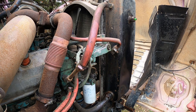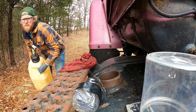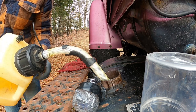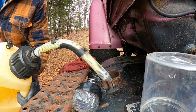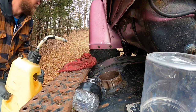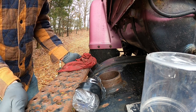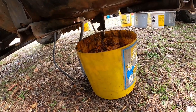So there was some dripping — I could see it from the other side, but I only used like 25 pounds, maybe 23 pounds, something like that. Fuel line's clear but it's still disconnected. What I'm going to do now is pour a little bit of this diesel fuel in here — not very much — just to make sure there wasn't any residual water or anything left. Let it run out into the tank. Fuel's running out nice and clear.